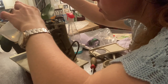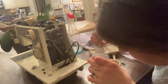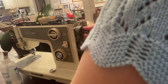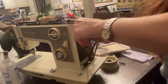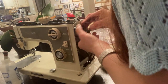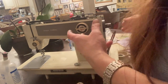So we're going to find the problem in a jiffy — I hope. Sometimes it takes forever, sometimes you have no idea what the problem is, and then sometimes you're like, 'Oh, hey, no big deal, there it is.' So if it's not the belt — which clearly it's not — let's just rotate this now. It's getting jammed in the uptake position. What I usually like to do on any of my machines — even old ones — you kind of rock back and forth and try to feel where the machine is resisting.